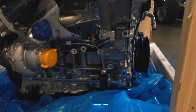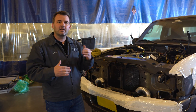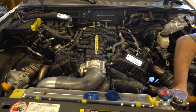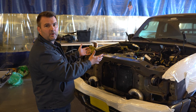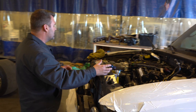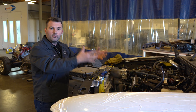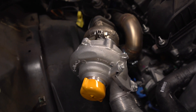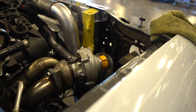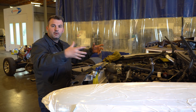We thought it looks like there's enough room, we could probably do it, and man, this was a tight fit, almost impossible. But with a lot of thinking and a lot of planning, we've been able to get the motor in. The problem was we couldn't actually leave the turbos on the side of the motor where they come from the factory — there's just not enough room. We were running into the frame, the upper control arms, steering issues, and EVAP issues. So what we did was pulled those turbos off, relocated them, and you can see right down in here these turbos have been moved. We've had to make new turbo manifolds coming off the motor in order for us to tie all this in, and we've had to design all those, get them cut out and made, and slowly get this put back together.